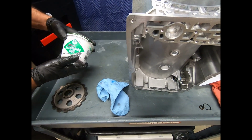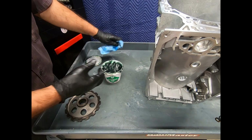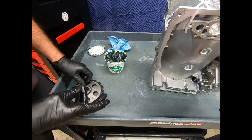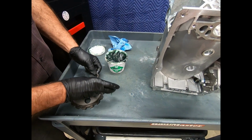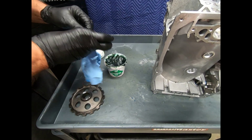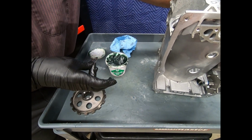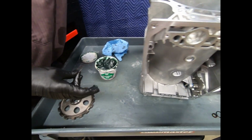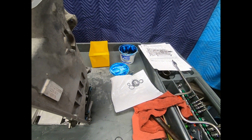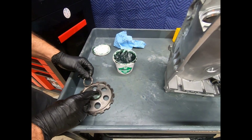And what happens is I have a lube guard, assembly goo, and this is specifically for automatic transmissions, and this is the green, and as you can see it's very, very heavy, very, very thick. And when I glue something down with this, it stays put. Normally they say this is the summer mix and the blue is the winter mix, but I really prefer the blue, Smart Blend Blue, year-round, especially if I'm working with any rubber seal. I only really use the green for some very special application, such as this right here.